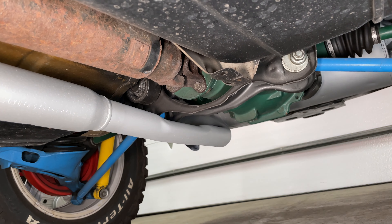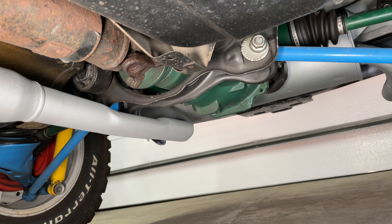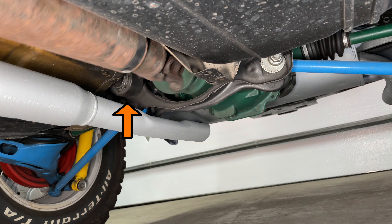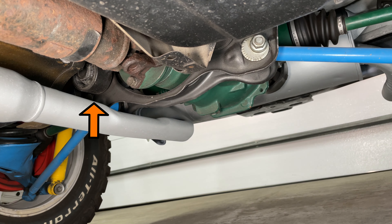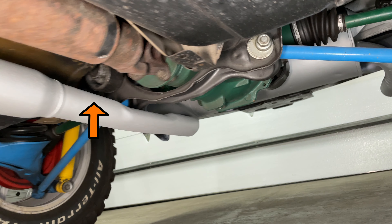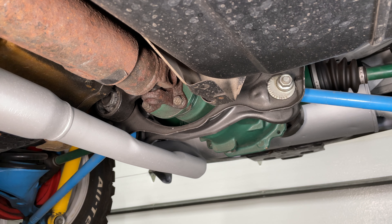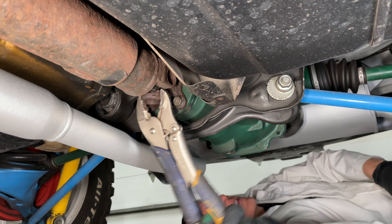The clunk is most noticeable when I drop the clutch. It looks like the differential mount is bad too — there's a ton of up and down movement. Today I'm focusing on the play in the driveline. That's a lot of movement too. I'm attaching vice grips to the differential yoke so I can watch its position.